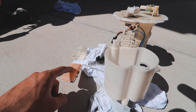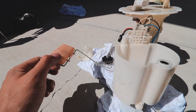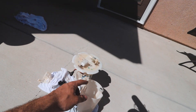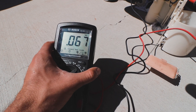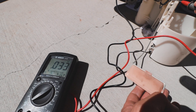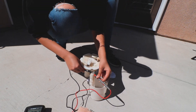This little plastic piece begins to corrode and the gasoline starts eating it away, and then this gets filled with gasoline so it weighs it down — so it's not able to change. That's one of the reasons it goes bad. Another reason for these cars is the contacts right here go bad, so they just clean it. This is measuring resistance — to give you guys a better understanding, this is the amount of resistance it has right now when it's on empty, but when you start lifting it up you can see that it starts to change. That's pretty much how a potentiometer works. I just wanted to pull this out to show you guys because it's pretty crazy how things work.